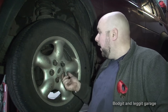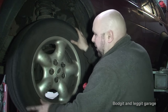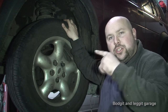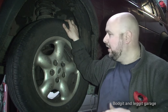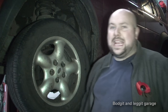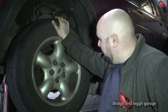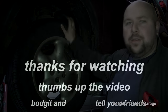That is the gearbox full. All I have got to do now is put the wheel back on, tighten it up, and tighten the top bolt in the gearbox — everything is done. You can give the driveshaft just a bit of a twist just to make sure it is in. Once you have done this, if you can, just put it in gear and let the wheels spin to see if there is anything leaking. If it is not seated, all the oil will come out quickly and your gearbox will seize. So take it for a drive then come back and check. Simple as that — we had problems with the bolts but it is all done now. Hope it helps, thumbs up and subscribe. Don't forget — get your hands dirty, see you for the next one.